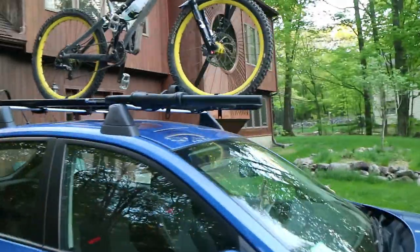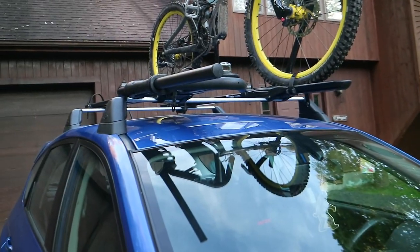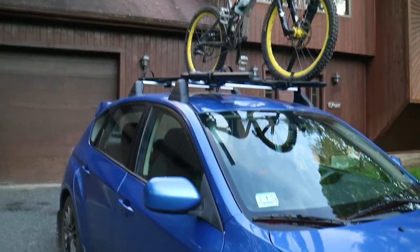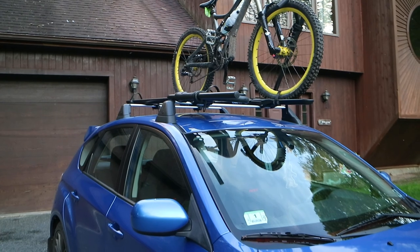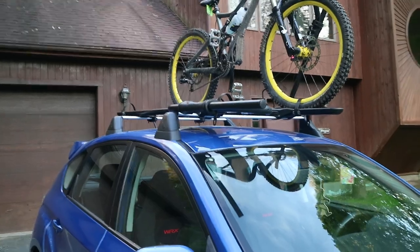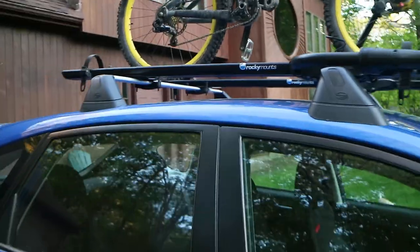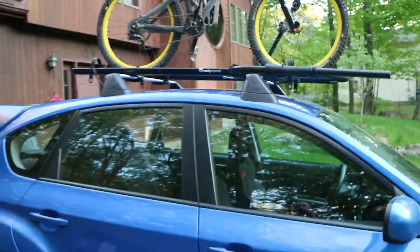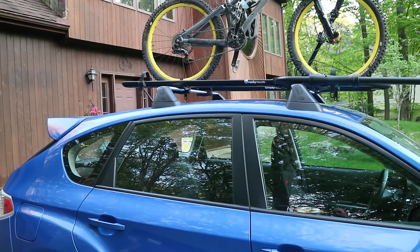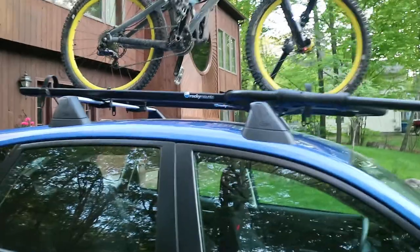I have two racks on there and with just the bars themselves they really don't make much noise at all, and my gas mileage hasn't dropped much — maybe like half a mile per gallon if that. I don't run a fairing on it. I've read that fairings actually cut gas mileage, and I actually bought a Subaru basket that came with these bars — it had a fairing on it. I liked the look of it, but it didn't really fit the racks well, and it was cutting my gas mileage like three or four miles per gallon. I actually felt the car act funny with it on there, so that went.